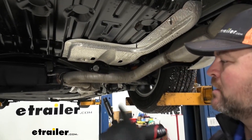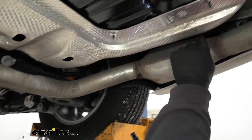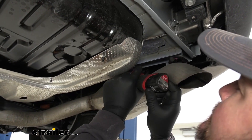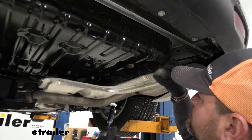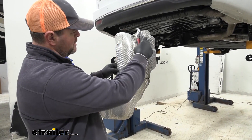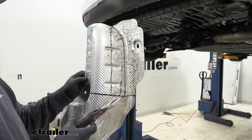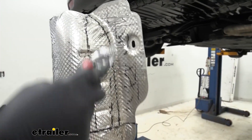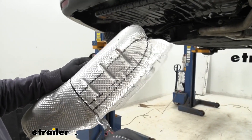Next, we need to remove our heat shield and trim it. We're going to take a 10 millimeter socket — there's a plastic fastener here and one right up here. Then we need to cut out a section of the heat shield. We're going to cut the part that's touching our frame rail. The directions say to go five inches up and 10 inches across, but what we really need to do is cut right along just above where it rolls there — that's what covers the frame rail. I'm going to use aviation shears to cut it off, then we can reinstall the heat shield.